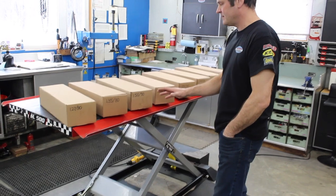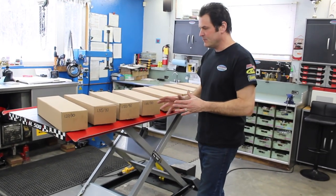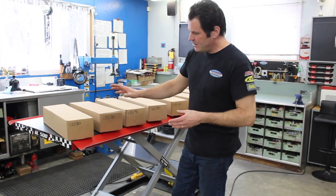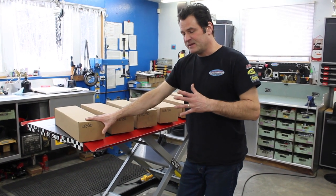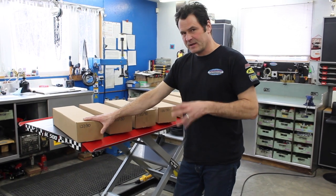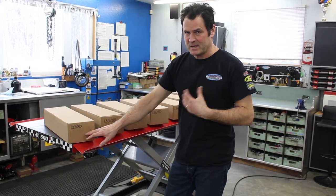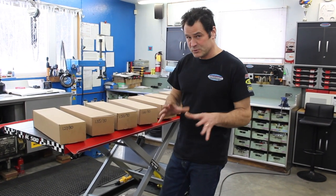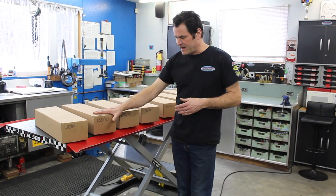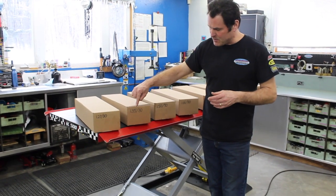These are a good range of torsion springs from Ski-Doo BRP. We start off at the 12780, which we see on the Renegade Enduro, because they're counting on the air shock in the back of that model to assist the torsion spring. This is the lightest spring we keep in our inventory — it's good for 100, 120, or 130 pound riders on a conventional snowmobile, not the Enduro.